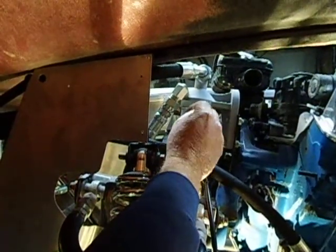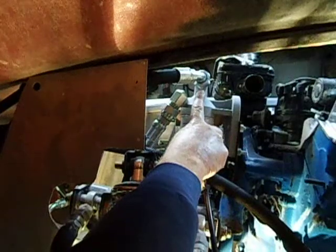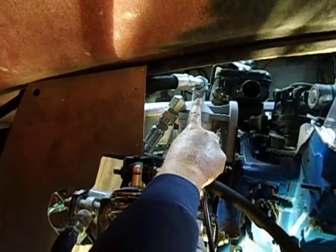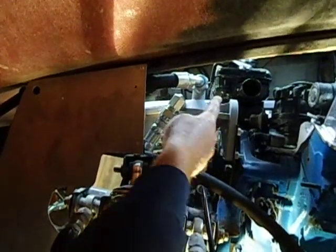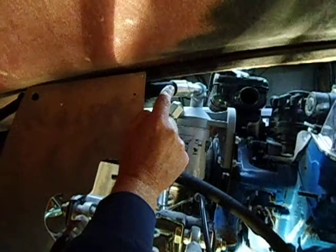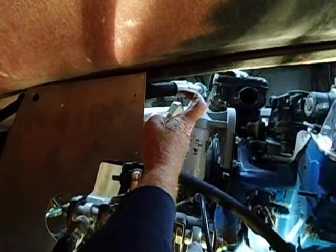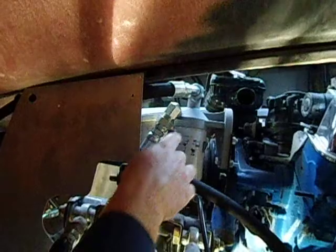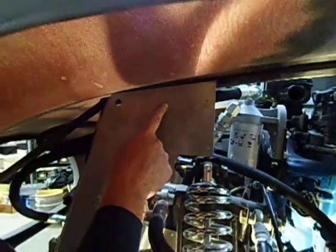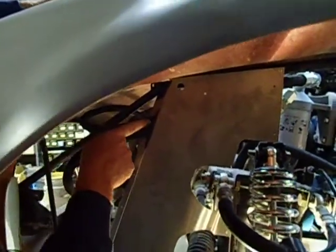We're now going to go to our second line. We're going to come out of the top of the oil filter and screw into a straight adapter — a pipe-to-AN straight adapter. Out of the straight adapter we connect our longest of the three lines, which is around 60 to 62 inches long. The first end we connect is the 45-degree fitting, which connects to the straight adapter on the top of the oil filter. We then run this hose through the inside of the inner fender, coming out through the top hole or the top of the slot for our hoses.